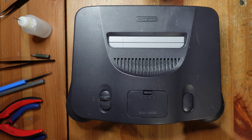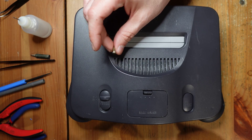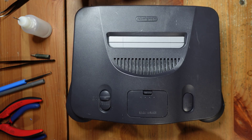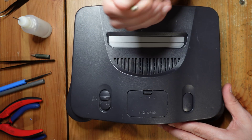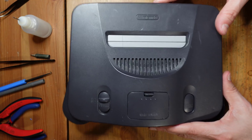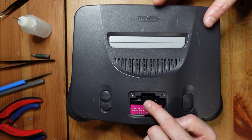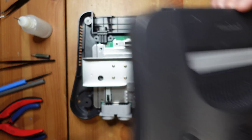I'm just going to briefly talk about how to take apart a Nintendo 64, because there are lots of different types of screws and you do have to pay attention to where all of them belong. Starting with these security bit screws — you do need a special type of screwdriver to get these removed and they're on the bottom of the shell. There are six of them and they just keep the top and the bottom together. Thankfully the tool you need is super easy and common to get — you can grab it on Amazon. Normally what I do at that point is just lift the entire shell off and leave the jumper pack in, because when you lift up the top shell you'll take the jumper pack out all at the same time.